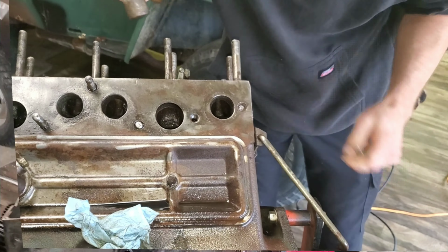It's just kind of a slow patience thing, kind of drilling away at it through the center, little bits at a time, and things that aren't 70 years old normally don't fight this bad. That's true. So don't let how horrible this is deter you. But I mean, this is kind of a worst case scenario. You can go from broken studs to threads.